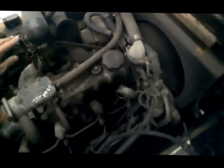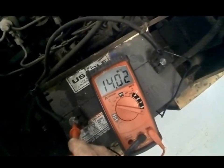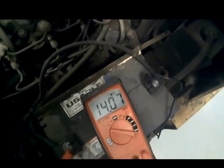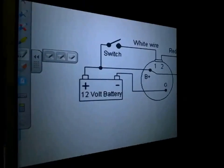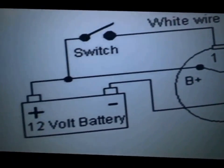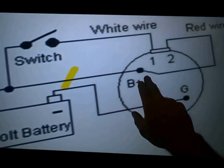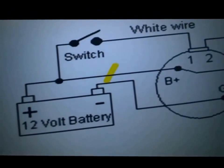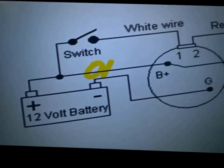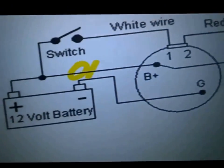It's running now. We're going to check charging system voltage and raise the RPM just a little bit. We've got 14 volts charging system voltage now that we've repaired the wire going from the alternator. I've repaired the charging system — there was a break between the positive side of the battery and the output of the alternator. It turned out there was a connector midstream on the harness that just came loose, so I just plugged it back in.